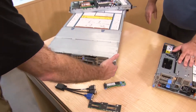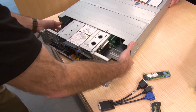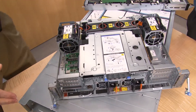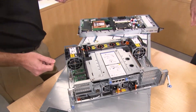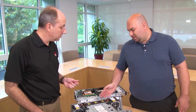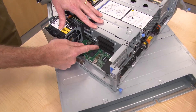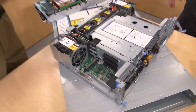Let's open up the IO tray. Simply unscrew the handles and pull it out — with the power off, of course. This is what we're calling the IO shuttle. The shuttle itself controls all the thermal — you can see the fans here — as well as the power, since the power supplies are in the back. What makes it unique is the EIOM module plus the PCIe lanes: via this connector there are two risers that give you, in this configuration, two by eight PCIe lanes per node. There are three slots visible on this side and a fourth on the back in a butterfly arrangement — so two PCIe x8 connections per node, direct connection.